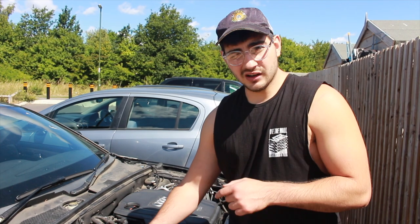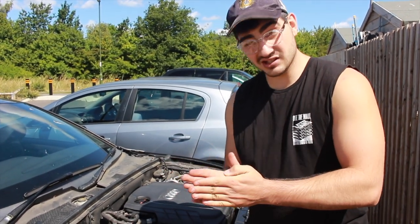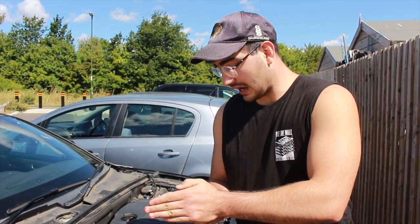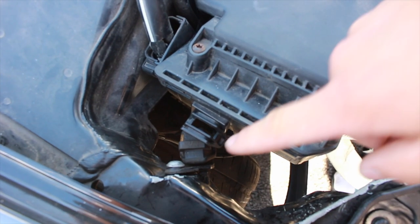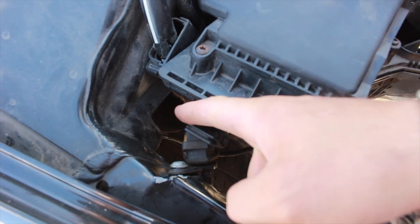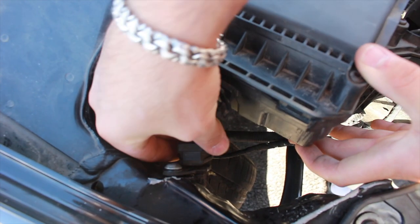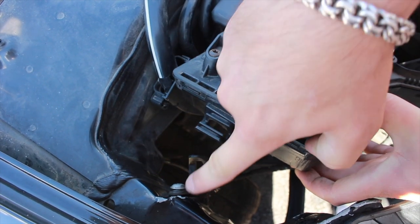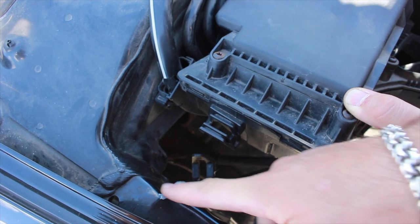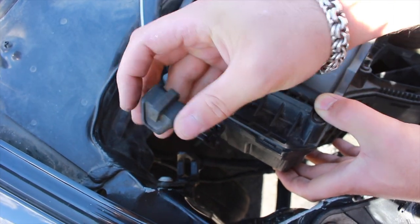When fixing the frame, I had to measure it up to the airbox because the bracket has got to fit on the side of the frame. It's actually a little bit off, so I'm going to have to straighten the frame up from the inside of the engine bay. The front of the airbox is meant to fit nicely in here with the rubber bracket, but it's sideways — so I'm going to take out the bracket, straighten up the frame, and then fit it back on straight.